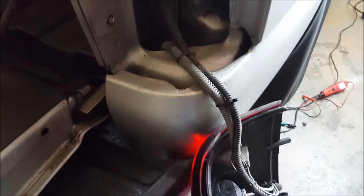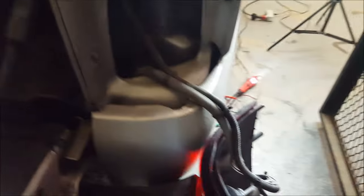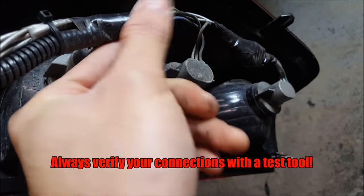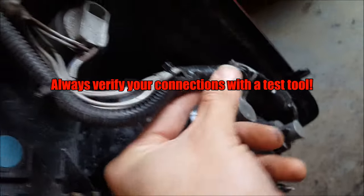We're in the back of the vehicle because one of my load resistors has given out and I don't know which one. The rear one's the easiest to change, so we're going to start there and I'm going to show you how to hook it up. You just have to find out which light is your actual signal. We're going to pick this light, which is this socket. This particular one has three wires coming out, so you're going to test the wires. I've already hooked up into it — I'll show you how to test it.